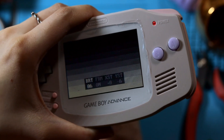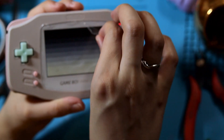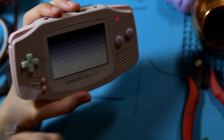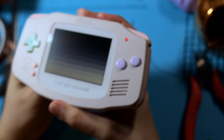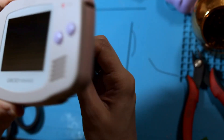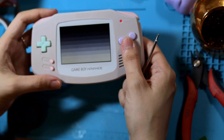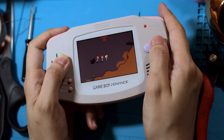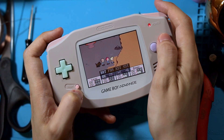You can see the brightness just popped up — that's because this installation has a touch sensor, so when you touch the top of the Game Boy, it adjusts the brightness. Take your time with this. Something I've noticed is that when you remove the screwdriver, it ever so slightly twists the potentiometer and you have to adjust it again, so be very careful when removing the screwdriver. And it looks good — then I'm going to go ahead and test it with a game just to make sure there's no noticeable flicker in real-life play.